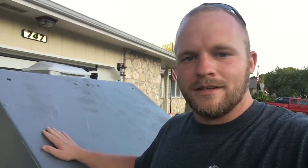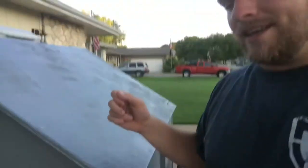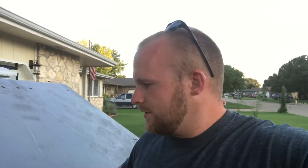I took a layer of paint followed by a layer of paint mixed with a sandy texturing they use for non-skid, which you can see there. The main reason I did that was not for a non-skid surface — because it is at an angle and only about five to six feet off the ground — but basically to deflect some of the light so it's not so shiny in my rearview mirror. And then a third coat of paint. So in all, it was two coats of resin with fiberglass cloth and three coats of paint — it is good to go.